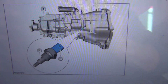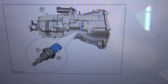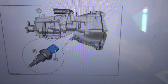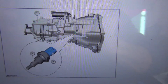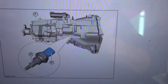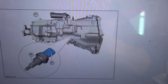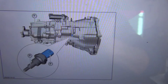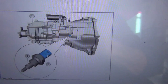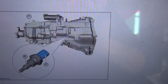The last thing on this circuit that it possibly could be is a temperature sensor on the side of the transmission. You would have to go to your transmission and look for this sensor and check your wiring that goes to it. If there's any chafing, it may be in that area. You can also disconnect the sensor and see if the fuse stops opening. Just remember that this could cause a fault and that the temperature sensor should not be left unplugged for any length of time. Hopefully that helps.